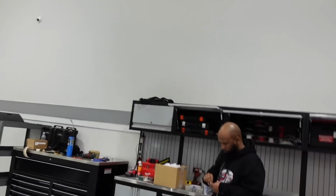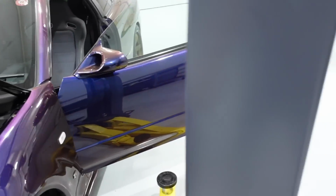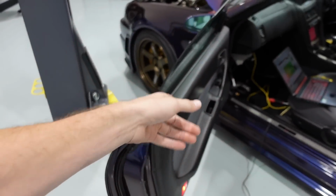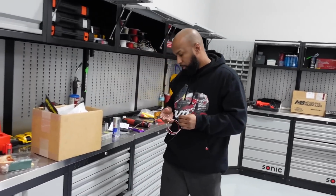This morning, me and Jamie tried to re-sort through the issue, now with some time, a little more knowledge, and some different sensors. Was it a mess? Mess is an understatement. Basically, when all the situations happened, there were wires that were cut at the ECU, so we had to do a bunch of tracing and continuity testing, and it seems like we got it working. So what are you doing now, Jamie? Just wiring up the MAP sensor, kind of the last piece.